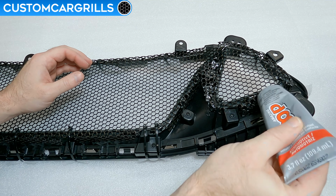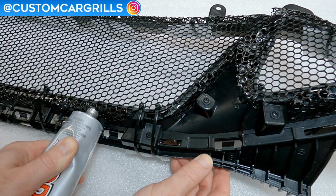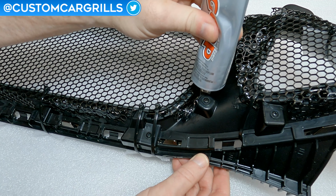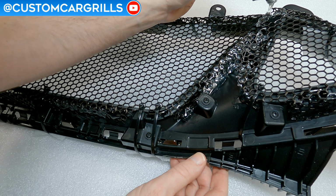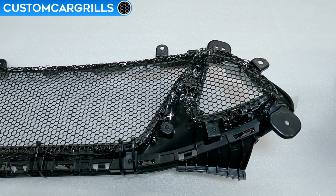This is a quick and effective method for dispensing the glue, but it's important to note a couple things about this type of install. First is that the glue takes a long time to cure. Plan on having these tied up for a day. On the other hand, the Plyo Grip can cure in just 30 minutes, but the cost of that adhesive is much higher than goop, so there's a decision to be made about cost versus time.